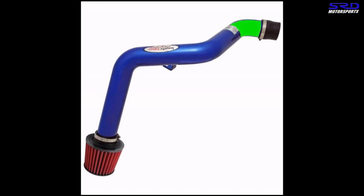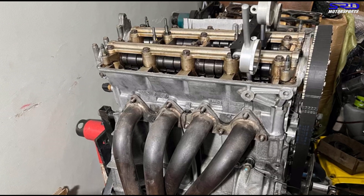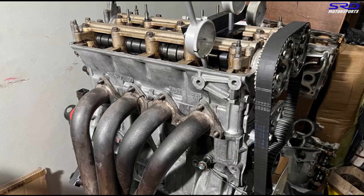Imagine the cold air intake or the length itself — it starts stacking up air, one on another. With the ported intake manifold, as the intake valve is closed, this is stacking air onto the ports, into the throat. As soon as the exhaust finishes scavenging, it creates a small vacuum on the chamber. As it opens, air rushes in — that's how you increase volumetric efficiency. We talk about this because Max's B20 VTEC is limited with the GSR cam, but it doesn't mean it won't make power. We're going to see how far we can go with it.